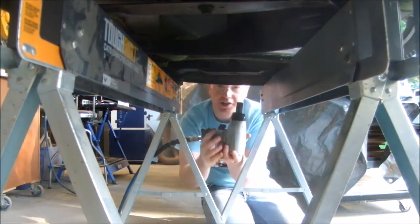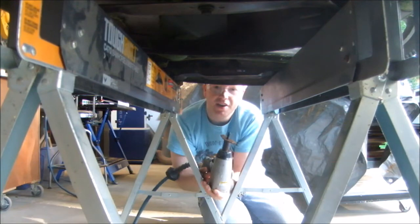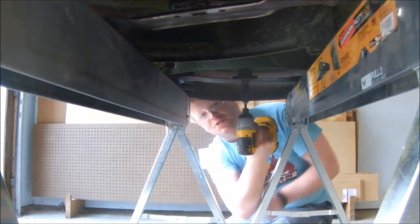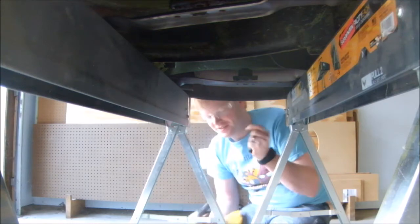It's pretty easy. And to remove the blade, I like to use an impact driver. It rotates so fast that it prevents the motor from turning. It doesn't have to be an air-powered impact. I have an electric, just a standard driver for screws. Takes it off real fast.